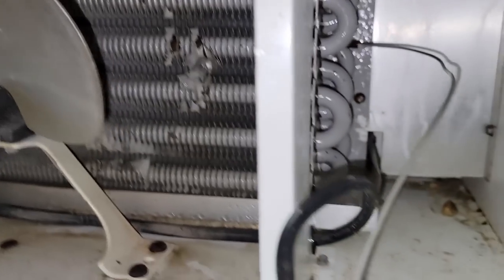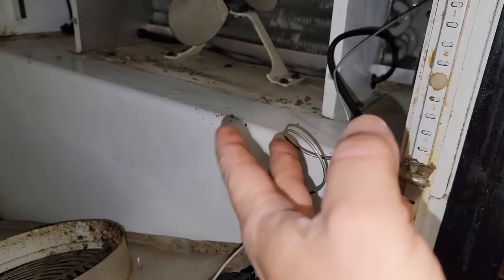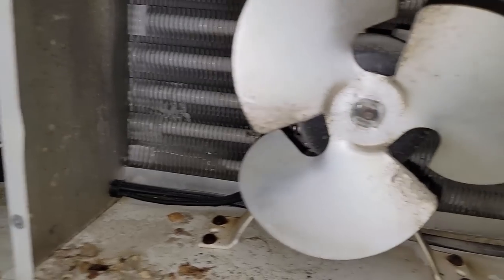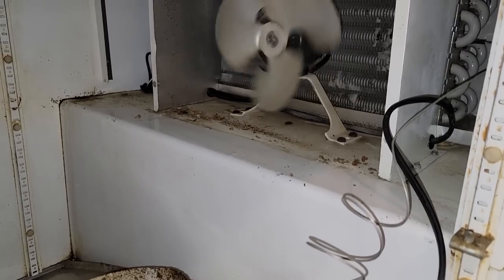What ends up happening is either the thermostat is not cycling on and off correctly — not defrosting properly — because this has a constant kick-in of usually around 39 degrees, give or take one or two degrees, and it's causing it to freeze up. Or it's low on charge and it never hits temperature, so it just keeps running and never shuts off, so it never gets an off-cycle defrost. I felt the condenser — it's really clean and felt warm, so there's a good chance it's probably okay on refrigerant, but it may not be.